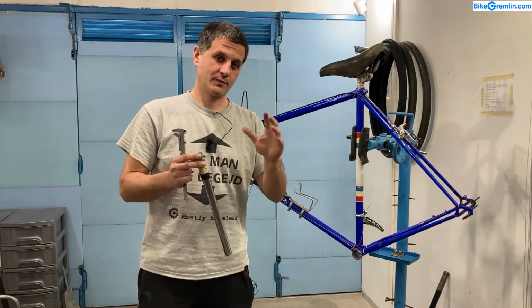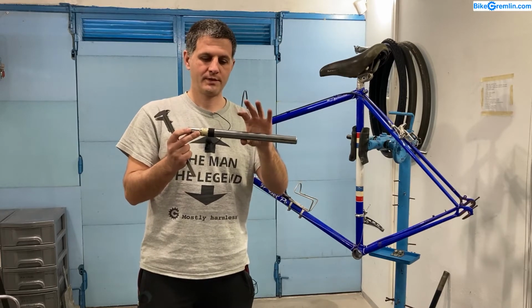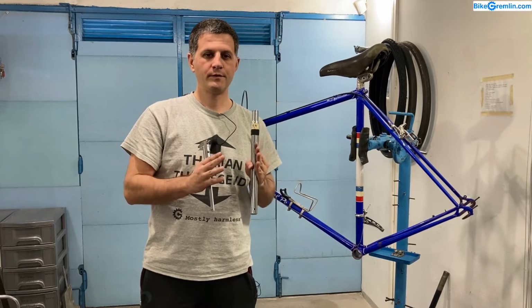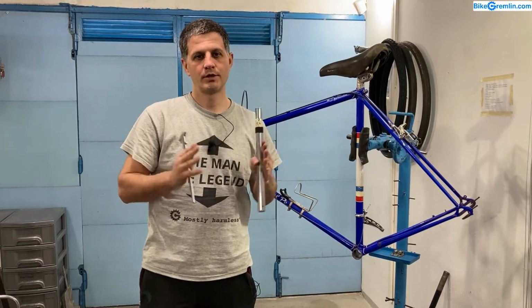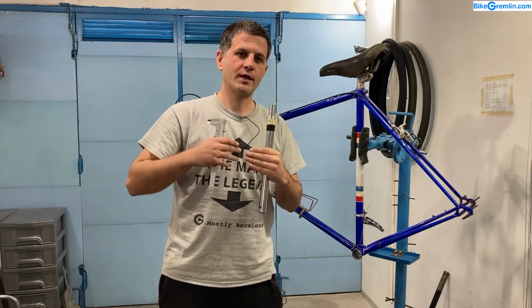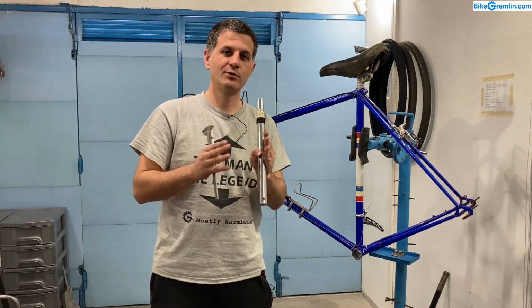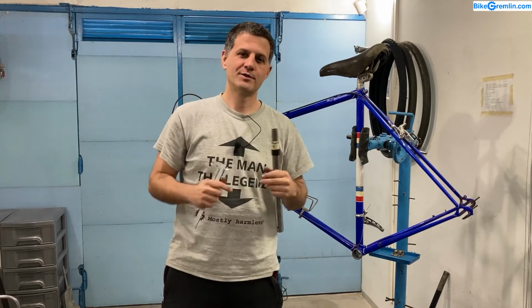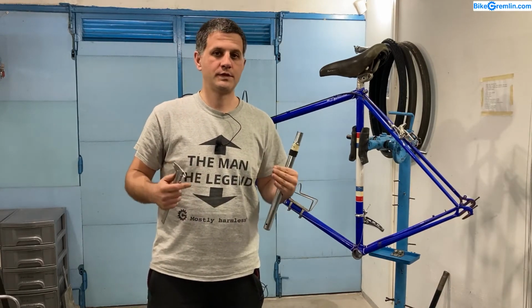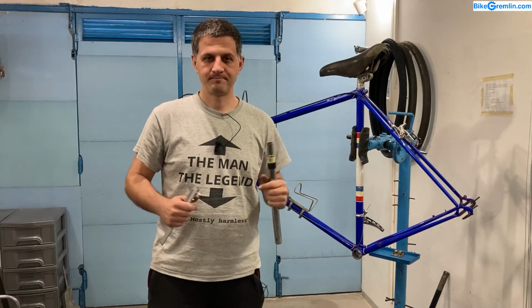It rises exponentially as the diameter increases, and as you make the walls thinner, the strength and stiffness does not diminish that significantly. You get more strength by making the diameter larger than you lose by making the walls thinner. So that is used to make a frame be very strong and stiff enough without being too heavy.